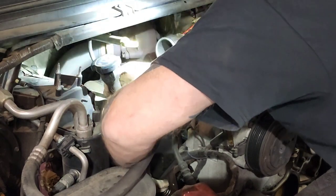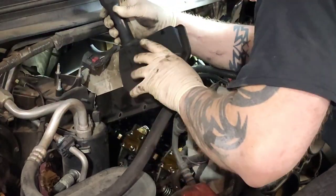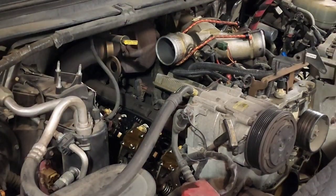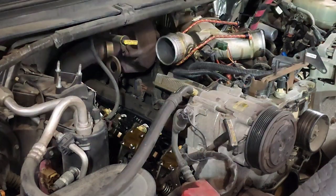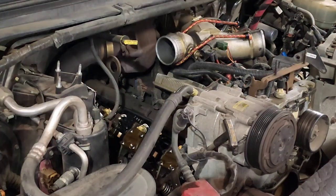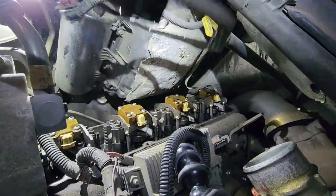The compressor does not have to come off, and you don't even have to take the oil fill tube off — the valve cover will still come out with the compressor on. You have more room and it's easier with it off. With the compressor on, that first injector is a little bit trickier and the valve cover gasket is a lot trickier because it has to go up and underneath the compressor. But you can get it — it's just that very first glow plug and injector is a little difficult. We use GB Manufacturer valve cover gaskets and they come with the harness attached.